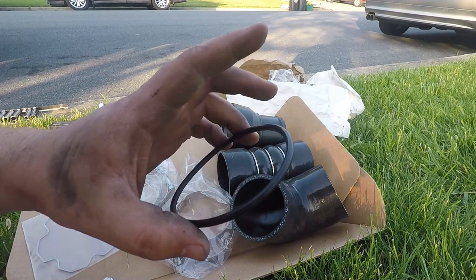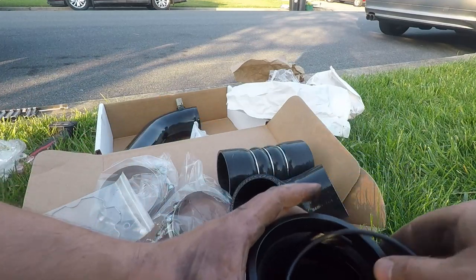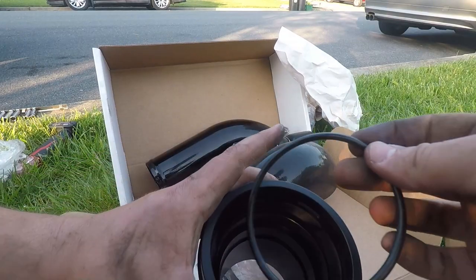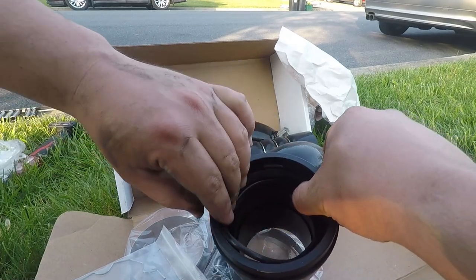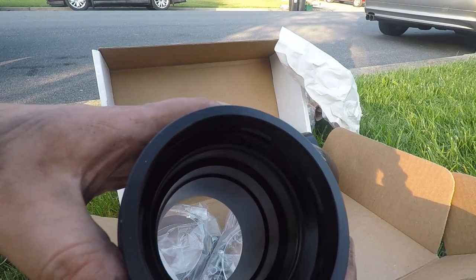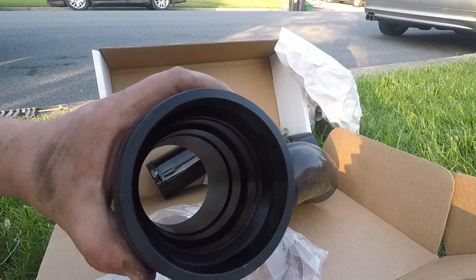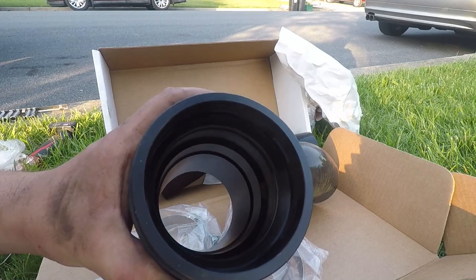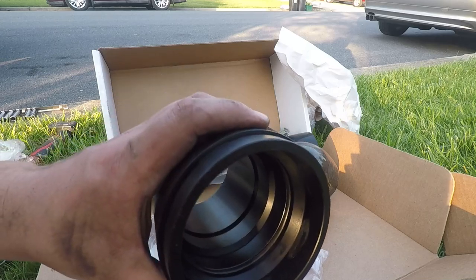It's a relatively thick diameter. Take your O-ring and pop it into place. As you push it in there's going to be a little wrestling — it's going to seem bigger for a second. I thought I had the wrong size but you keep working it in and you'll get it in there a little at a time. If it seems bigger than it needs to be, it's not — you just have to keep messing with it. It'll seat in there perfectly.